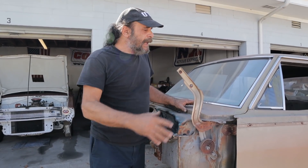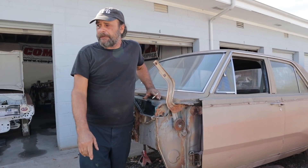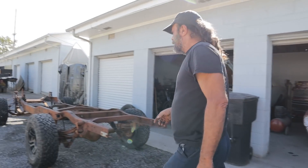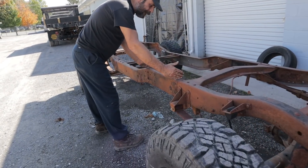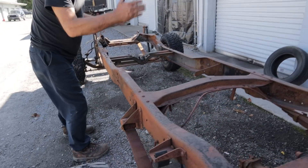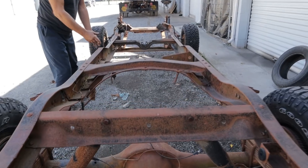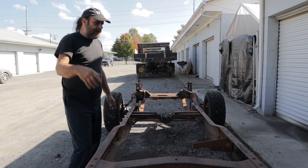So this is where we're at with this. This is a 108-inch wheelbase, that's a 128-inch wheelbase. I said this is really easy — this chassis has a 20-inch section right here that I could just lob right out of it, roll the back section up, graft it together, and then I've got a 108-inch wheelbase thing ready to go.